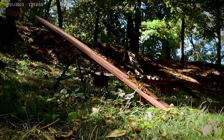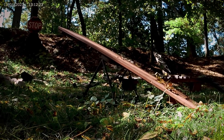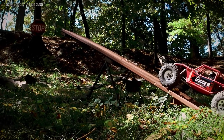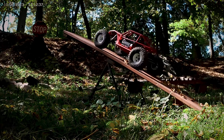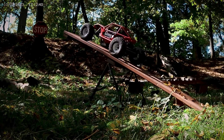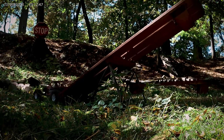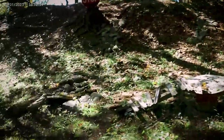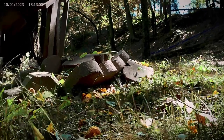I've noticed that this Fusion system has got kind of a jitter to it when you're rolling over obstacles like that, those pavers there. At least when you're at a real low RPM. Not sure if it's because the gearing's so tall on the Capra, if it's a little bit of a cogging or something, or if it's just that FOC searching for its position, trying to keep the RPMs matched. But it's not terrible. I think everything else is just so quiet that I can actually hear it.